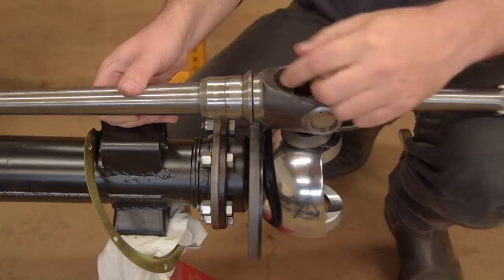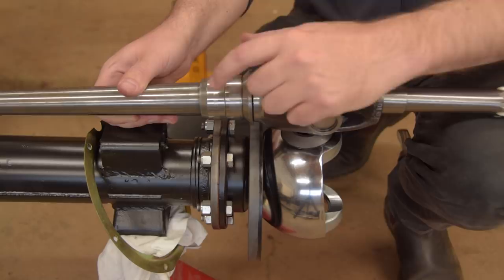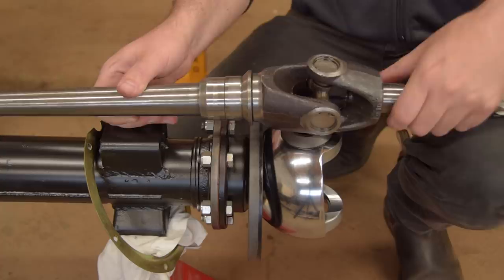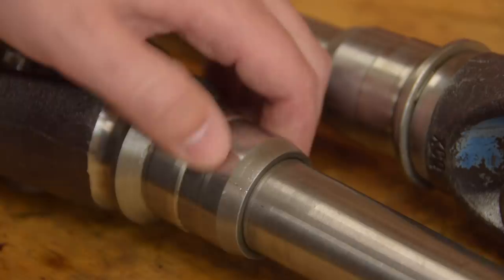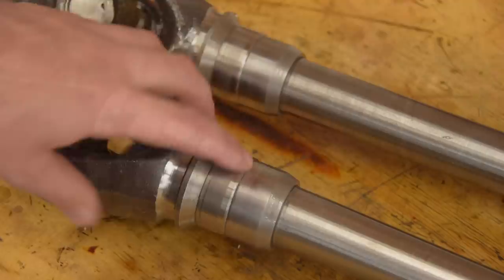These half shafts have two collars. The inner collar is a bearing race so that should be fine. The outer collar is an oil seal surface, and on a high mileage truck you'll probably have to face your demons and change out a worn collar. Lucky for me this truck has had freewheeling hubs fitted so the front driveline has very little mileage on it. Although you can see where the seal has been rubbing I can't feel a thing, and that mark will completely disappear with some fine sandpaper, which isn't really necessary but it does help show any deeper nicks.